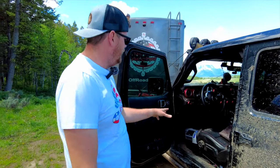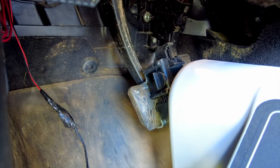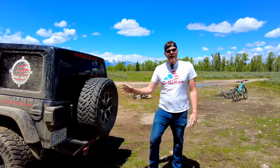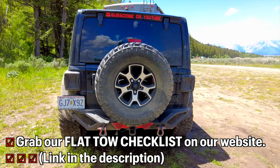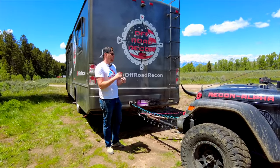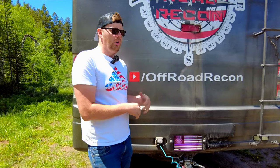You've also got a light button so you can leave the system lights on. Now I'm going to apply the manual brakes from inside so you can see how the Patriot brake system works. It's almost like having trailer brakes — the adjustments, tuning, and braking are very good. One quick tip: make sure your brake lights are not on all the time. If the system is too close to the brake pedal it'll keep your brake lights on constantly, so make sure that's not the case.